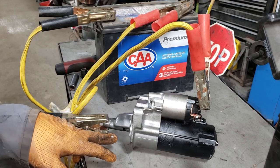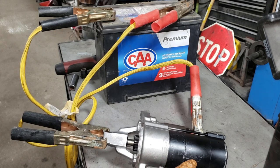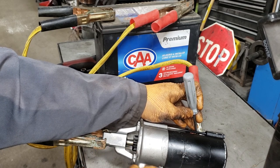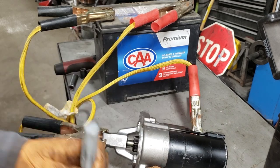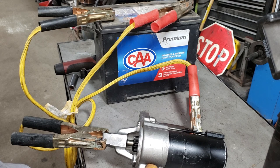That clicking was the starter gear engaging. We'll get that on camera so you can see exactly what's happening every time you start up your car. Basically this gear throws out in this direction and connects with your flywheel. That's primarily how I got sucked into being a mechanic. Anyhow, we have a good starter and I'll see you back soon.